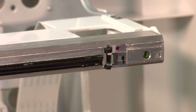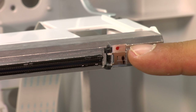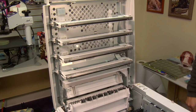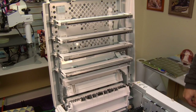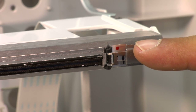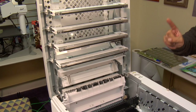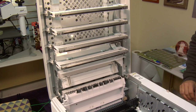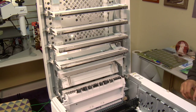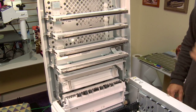The first thing we want to identify are these strips located along the top of the lid. These are your LED print heads, which command the image drums where to deposit the toner. What you want to make certain is that you do not touch these print heads with your fingertips. The oil off of your fingertips will affect the way the unit prints, so make sure not to touch these with your bare hands. If you need to clean them, just take a lint-free cloth and gently wipe in one direction.